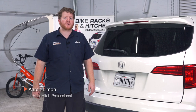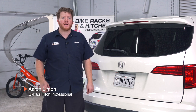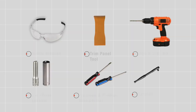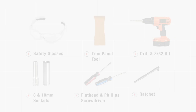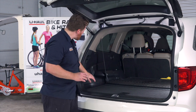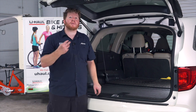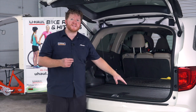If you're planning on towing a trailer with your Honda Pilot, you have to have trailer wiring installed — it's required by law. Let's break down that install. You'll need the tools seen here to complete this installation. Honda makes this really easy for us: we have a pre-wired plug that is all ready for towing right behind our driver side harness. All we have to do is plug in our trailer wiring to it, but first we need to take apart our paneling to get there.